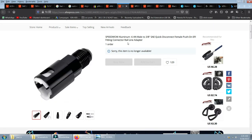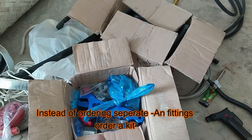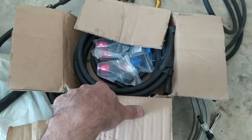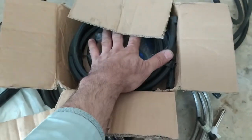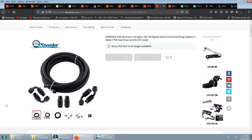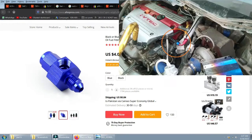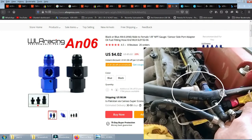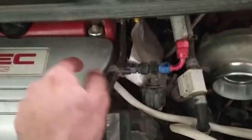I won't go into the details of how to make AN lines — you can find many videos online. If you want to convert to AN line, I ordered a kit for about $30 which came with a good length of pipe plus essential fittings: 90-degree, 45-degree, and all the fittings — order the one with white PTFE lining inside. If you want to add a fuel pressure gauge like I am using, you will need an AN6 male-to-AN6 female adapter with a gauge port. The sensor connects just before the fuel rail.